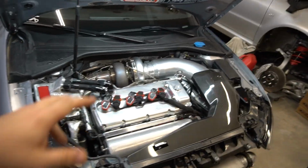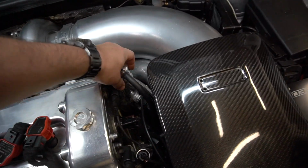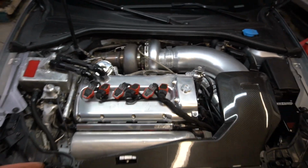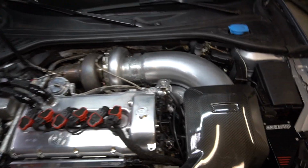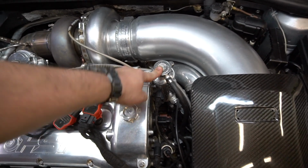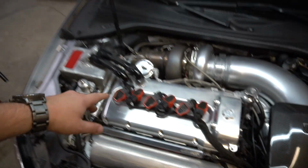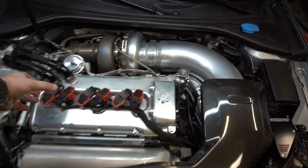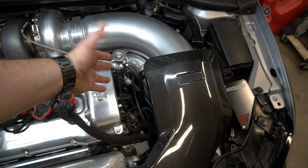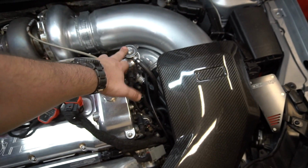I don't know if I have to remake it or relocate it, but we ended up deleting the stock coolant bottle, and I ended up getting this little sucker and then modifying it, mounting it here in the back of the valve cover. I think it looks a lot cleaner and nicer. I am noticing, though, that the volume is really small. So we have a 20-pound cap on here. So it ends up pushing up the cap a little bit and squirting out a little bit of coolant. So I'm thinking of either going back to the OEM coolant bottle, relocating this catch can and making two lines come around and making the catch can back here, or going with something with a little bit more volume, maybe a larger canister, something a little bit beefier here, so when it expands, it doesn't push this cap open and spray.